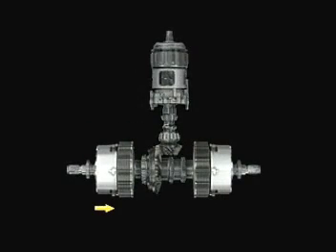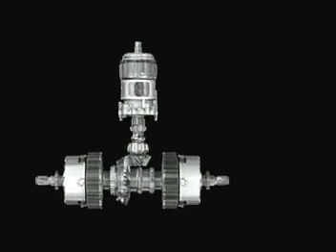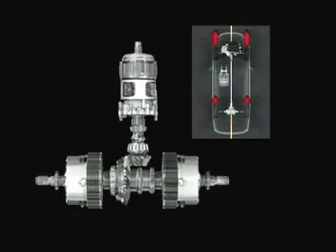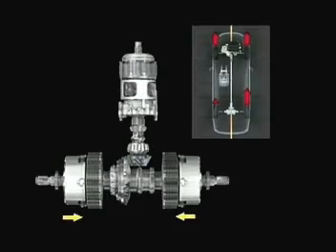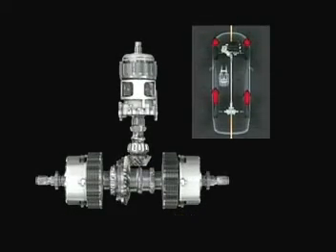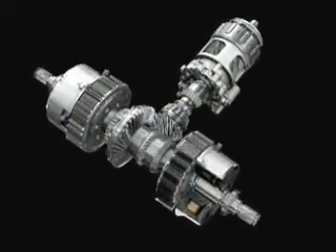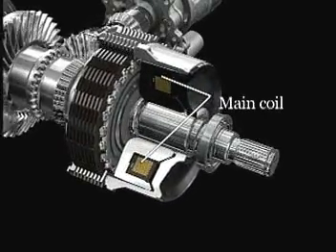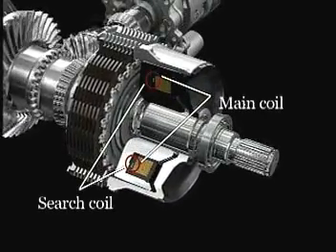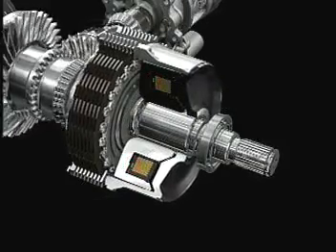In addition, independent control of the left and right electromagnetic clutches is used to freely control the torque distribution between the rear wheels. SHAWD uses this configuration to achieve highly precise front-rear torque distribution and independent control over lateral torque distribution to the rear wheels. The electromagnet features surge control to detect and correct the gap between it and the magnetic body, ensuring continuous high-precision clutch control.